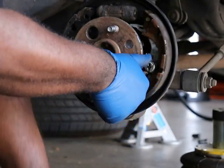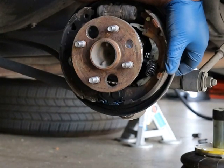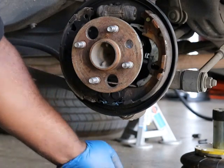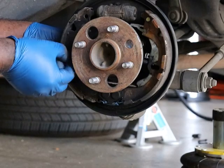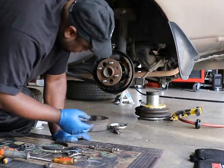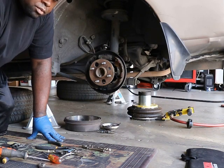Hold the pin in the back — you've got to hold the pin in there. There we go. See how easy it is the second time? Good job. We've got all of the retainers off, so now we can remove the brake shoes and the bottom spring together.